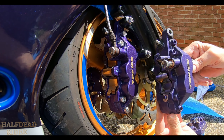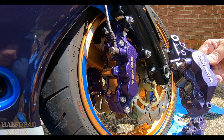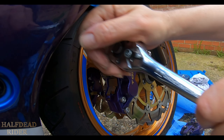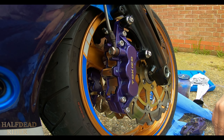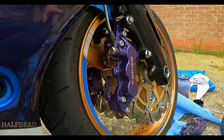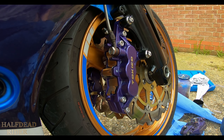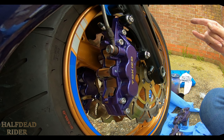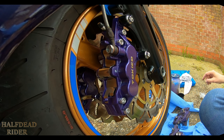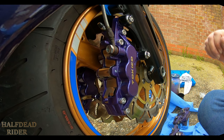That should be good. Look at that compared to the old one — you can see the paint isn't quite as vibrant as it once was. Just double check that's tight enough — doesn't have to be stupidly tight, just enough to crush these washers. What I'm going to do now while I stop recording: I'm going to top up the reservoir at the top, go to the other side, put a bit of tubing on the bleeding nipple, then suck some fluid through with the syringe. Then come back around, start recording again, do that this side. Once you get some pressure in the system you can then take the syringe off, have the PVC tube on the bleed nipple going straight into the jar, and bleed as normal — pumping the brakes, open, close, pump the brakes.